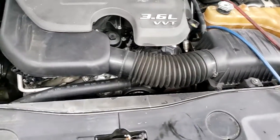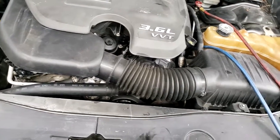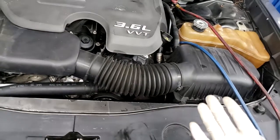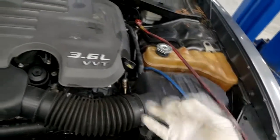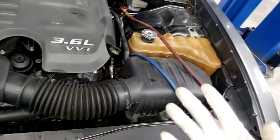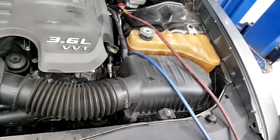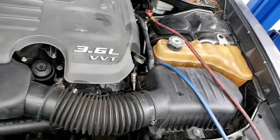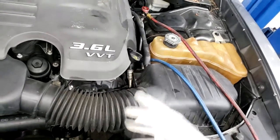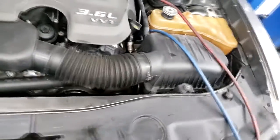Here's what I want to talk about now. I suspect I didn't lose much oil. In fact, you really don't know how much you lose, if you lost any, because I simply removed all the old Freon. When I install Freon, of course, I'm going to bring the system under a vacuum because I had it open, guys. Vacuum is very important. You want to remove as much moisture out of the AC system as possible, that way you get better AC performance. So I'm getting ready to do all that.